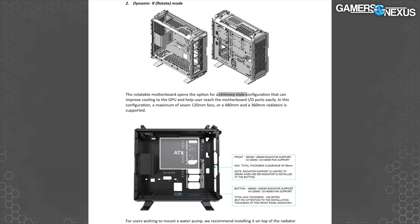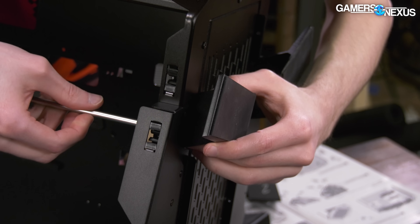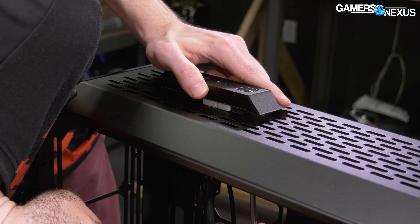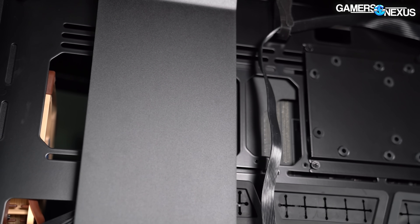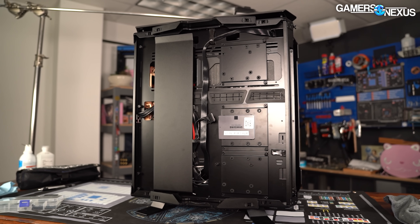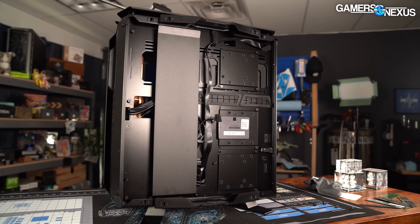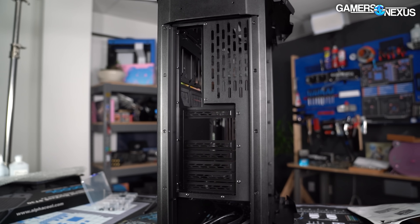Lian Li has called this a chimney orientation, with the implication that airflow should go bottom to top, putting intake fans at the bottom of the case. In performance mode, the legs are moved to attachment points on the spacers and canted forwards and backwards. The former top panel is moved inside the chassis to act as a cable cover, while the former front panels become the top panel. Front I/O is detached and moved to the center of the new front panel. The side fan slots aren't usable in the performance configuration — they're not positioned to allow fans to do anything useful. The distinctive bowed-out sides don't contribute meaningfully other than maybe larger air cooler support, and the dynamic already supports this. There's increased cable management space, but it's undesirable since it's all through clear panels. There are also 1.2-centimeter gaps that appear, but they don't line up with any fans. There's potentially space for pumps, reservoirs, or vertically mounted GPUs, but there's no built-in mounting hardware, so all of the possible opportunities were missed.